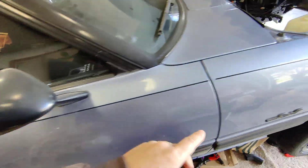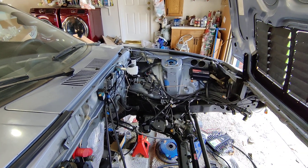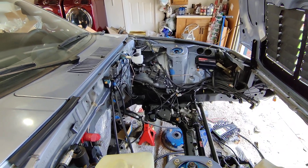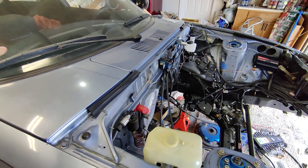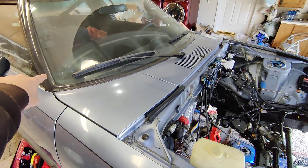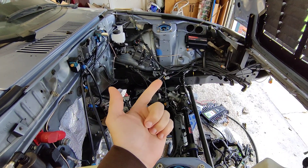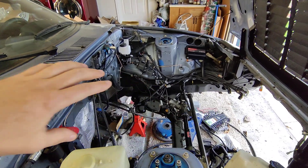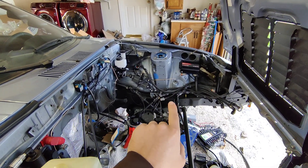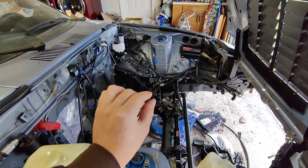Now we know how that's routed. The idea of why — when you have a 400-amp draw from the starter, or a CDI box that's 60 amps off of here — you want this to be as correct as possible. Thinking purely in material sciences, you would want to have oxygen-free copper direct to the battery on everything you can. Copper is pretty much one of the best conductors, and oxygen-free copper will last forever on a car. Your resistance from the center point of an engine to everything off a single star point is going to be our lowest resistance method.